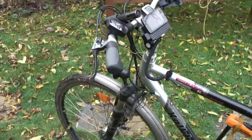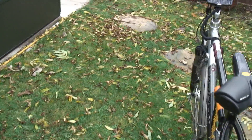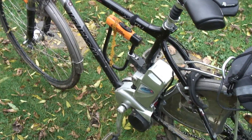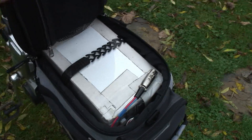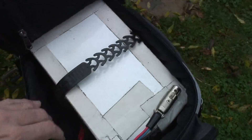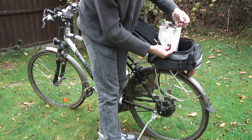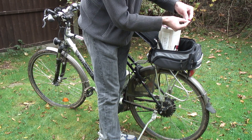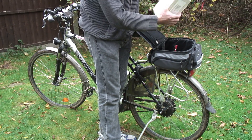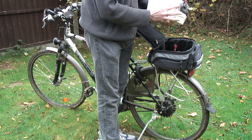I used to do some very long distance rides — down to the south coast, about 75-80 miles. On a 10 amp hour pack I could get about 25 miles, so many years ago I modified this bike and added in the back an additional 20 amp hour pack. It's secured with a wrap strap, connected with Anderson connectors rated at 20 amps. These are really handy because you can make up your own connector patterns — the blocks slide together so you can key them your own way. That's my 20 amp hour, 9-cell lithium iron phosphate battery pack that I put together.